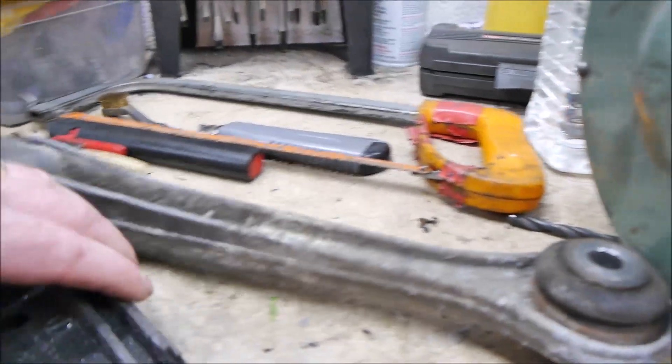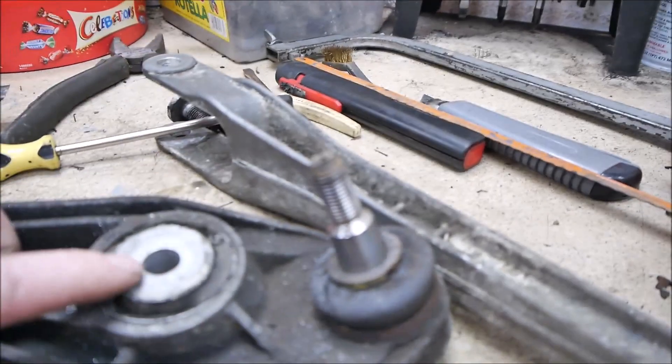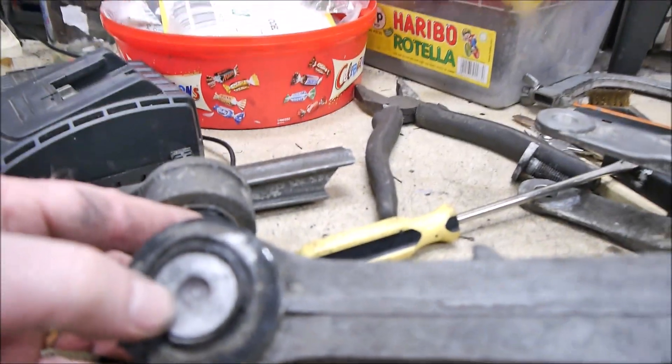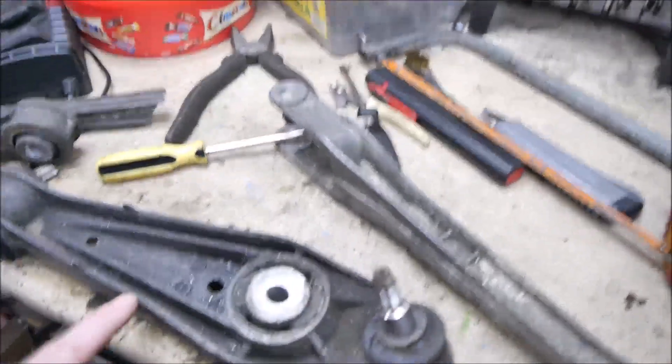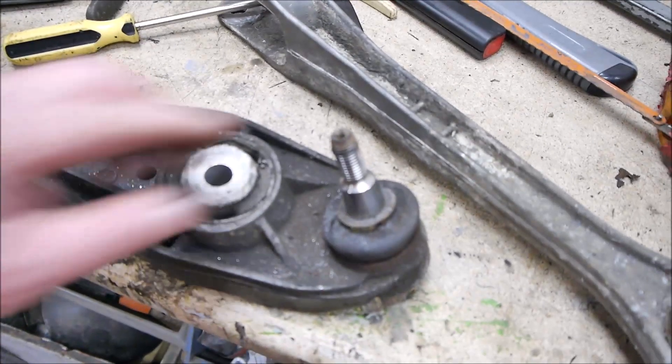This one is the coffin arm - you can see why it's called that because of the shape. This and the rear control arm: annoyingly, both of them don't have much play in the bushes, so they would have been good to go other than the fact that this bolt was seized in here and I couldn't adjust the camber. I suppose I could have left it because the camber wasn't too bad, but the toe - the tracking - is way out, so I've taken these off.